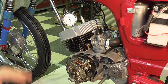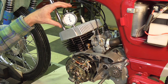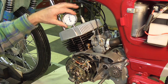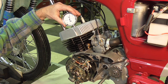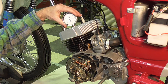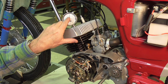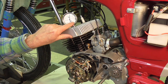What I'm going to do now is lift this indicator up and watch that inner dial. I'm going to push it back down just a bit until that little indicator comes around to 100 thousandths, and I'm going to put the needle pointing straight up, then tighten the set screw holding the indicator in place. So we know right now that right there is top dead center of the left piston. I'm going to rotate this dial around to read 71 thousandths.